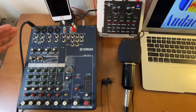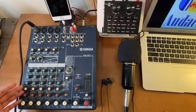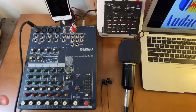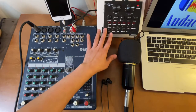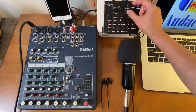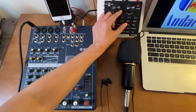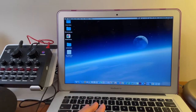Let me quickly show you my settings on the mixer. Gain is at about 10 o'clock, the mid is at 12 o'clock, and pretty much everything else is at 12 o'clock — maybe a 1 o'clock — and volume is at about 10 o'clock. You can adjust the vocal effects to your preference. Since we're connecting the V8 sound card, you can also add more reverb from the echo knob — turn right for more echo. Adjust treble and bass to taste. For the record volume knob on the V8, always make sure it's on high.